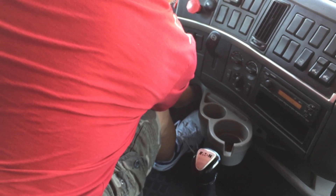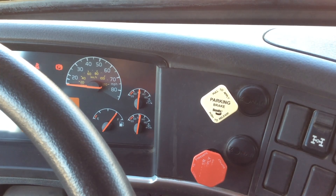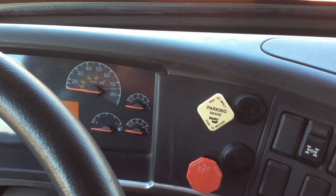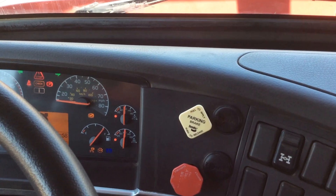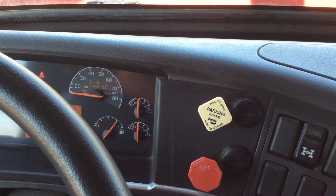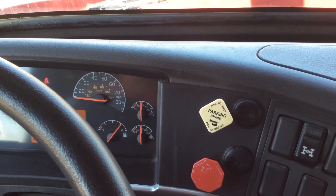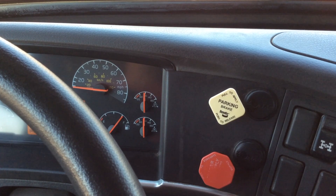Now do the brake test. Put your truck in gear in a low gear, turn your truck off, let your clutch back out, turn your key back on for your gauges to work, and release your brakes. Let all your air settle. Once it's settled, start your air leakage test: hold your service brake down for one minute and you should not lose more than four PSI in that one minute.